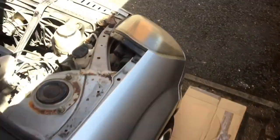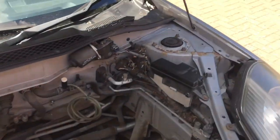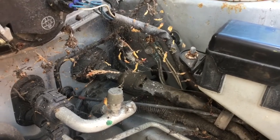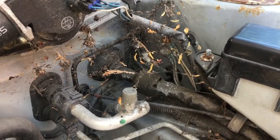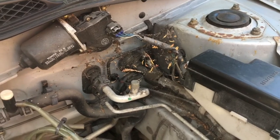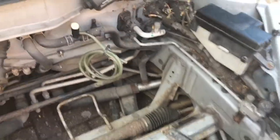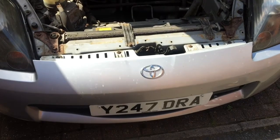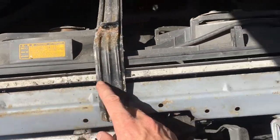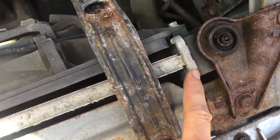The whole lot lifts out and we have a filthy under-hood. This is what happens when you leave an MR2 parked outside under a tree too long. An MR2 mechanic who's internet famous in the UK — his name is Dick Sloan — when I told him the problem he said straight away: 'Near-side radiator, they always leak. It's an MR2 thing, get a new one off eBay.' So I went straight to the radiator. It's one of these thin aluminium radiators with plastic tanks at either end, which are prone to leaking.